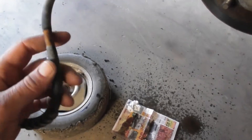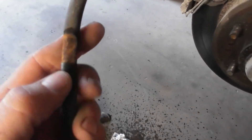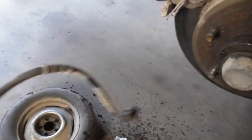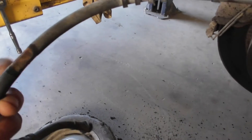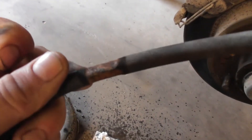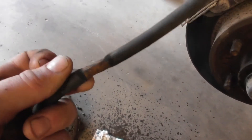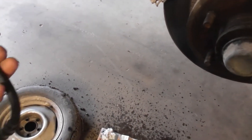Here's the old one. I believe what happened is it collapsed because of the clamp — it holds the hose up here on the A-arm. Squeezed the hose down, made it collapse, which that's what it looks like happened. We've had that happen quite a few times on brake hoses.